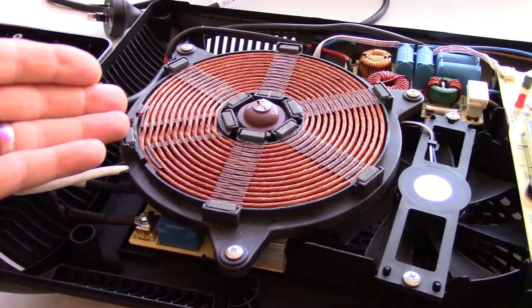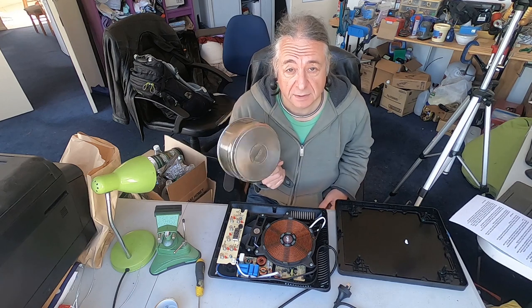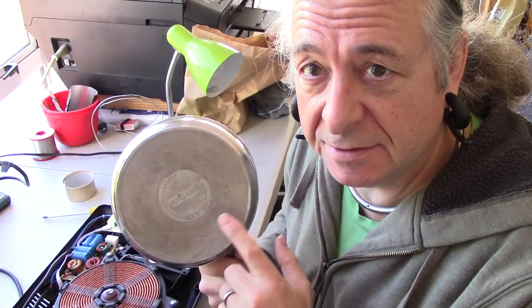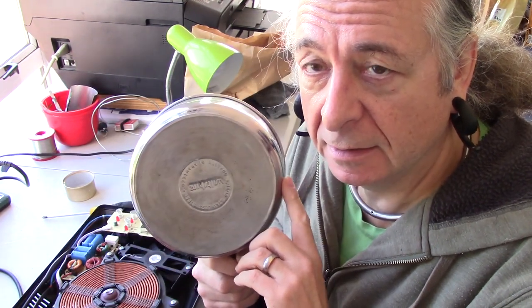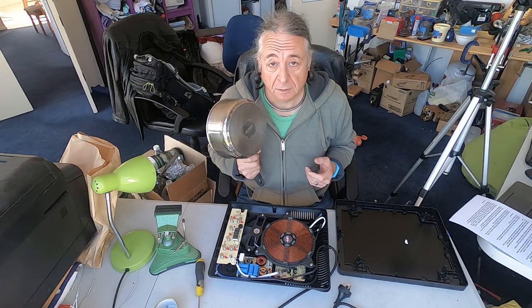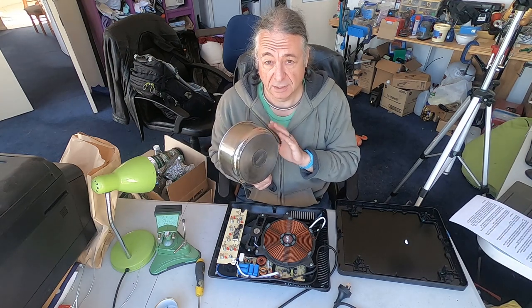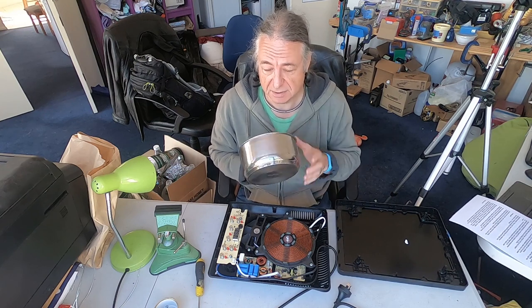This is our transformer. Actually, it's only half of the transformer — the other half is the bottom of the pan. It induces electric currents directly into the bottom of your pan, much like the transformer in our arc welder rig earlier. This is why it's called an induction hob. The laws of physics say that the electricity stays right here in the pan, being turned into heat directly — hence the efficiency.